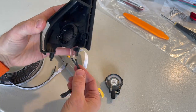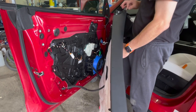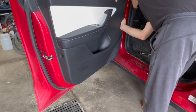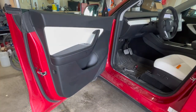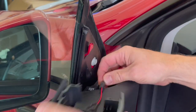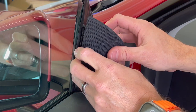The tweeter fits in pretty nicely — make sure all the clips are fully around the speaker. Now this is ready to go into the car. Let's put the door panel back on, making sure the tweeter cable attached to the door is still sticking out. Get the panel into the top lip, line up all the pins, replace the screws, and pop the reflector back on — note there is an 'up' orientation. Then plug in the tweeter cable, align the two clips and the hook latch.